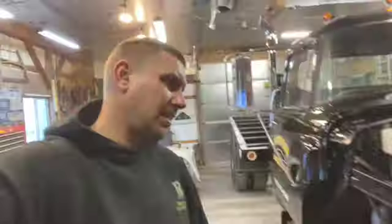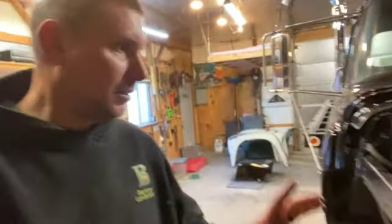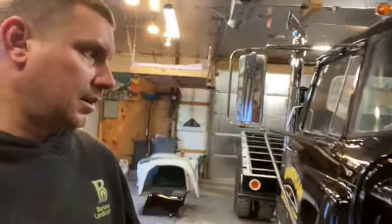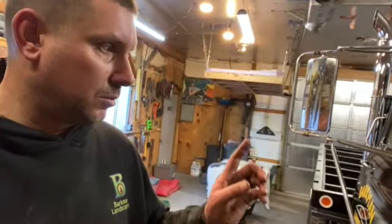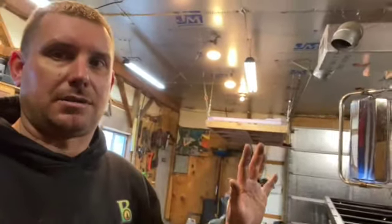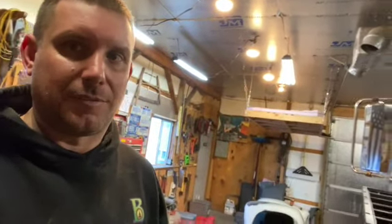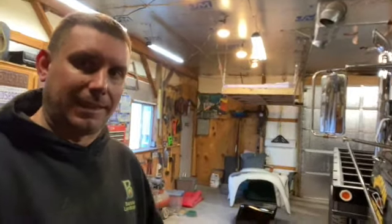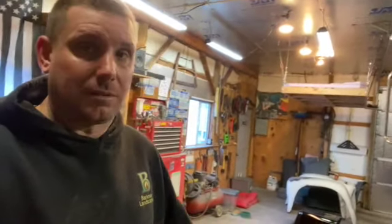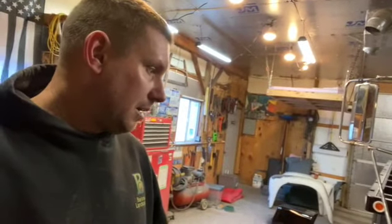We'll be right back. I'm kind of recording these out of order, but I'll get them lined up in the video. Just real quickly, I'll go through what I got accomplished today, more than I thought I would, to be honest with you. So we got the air brakes 100% adjusted. They work awesome. I could probably get by with just the rears, but from a safety standpoint, just in case something runs up or pulls out in front of me, I'd like to have the steers. But the rears stop the truck pretty damn good. So they're good to go.